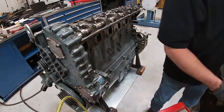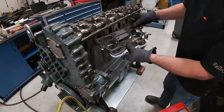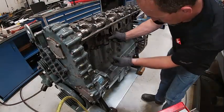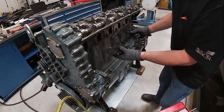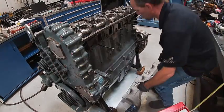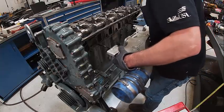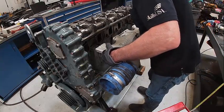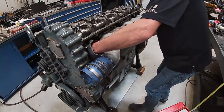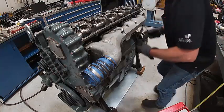We're going to install our intake manifold. I've got new gaskets — note the arrow towards the front of the engine. If I had enough guide studs I could put guide studs in here, but I screwed up. The guide studs couldn't go where I had them, so from there we can take and put our other gasket.